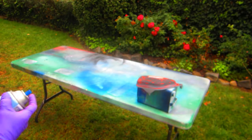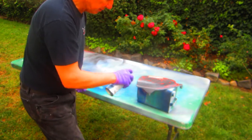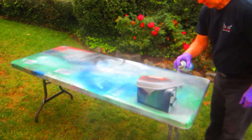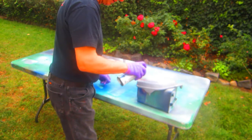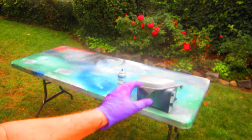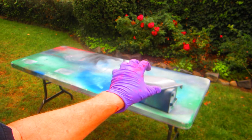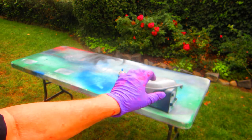This primer has a sealer in it which usually — not always — works pretty well on these type of plastic parts, and especially Ducati mirrors which have another tendency to have paint issues. In our case it's best to get on two or three coats about twenty minutes apart. We're going to let that dry and see if the paint crazes. If it doesn't, twenty minutes from now I'll work on the other part. If you try to get it all on in one coat where it might run, it has more of a tendency to melt the plastic.